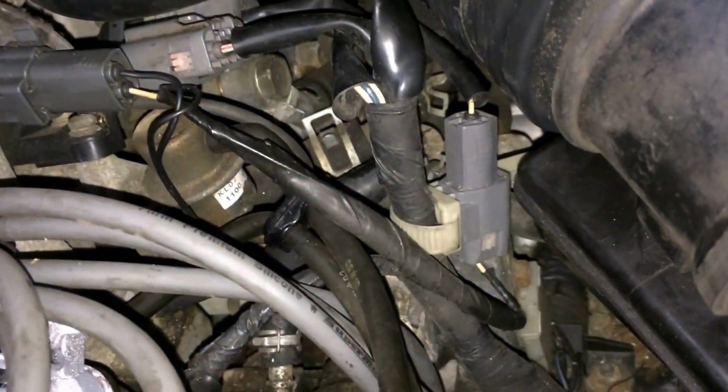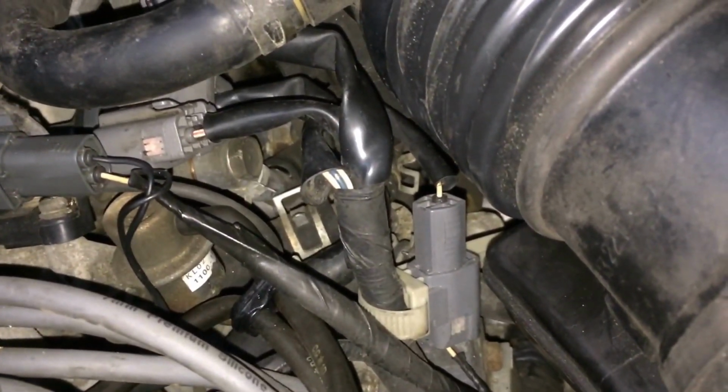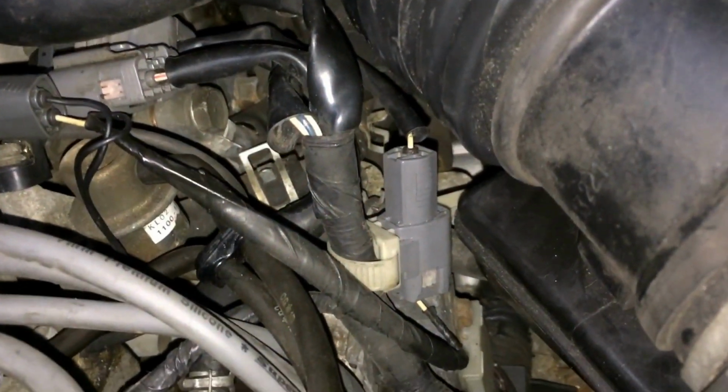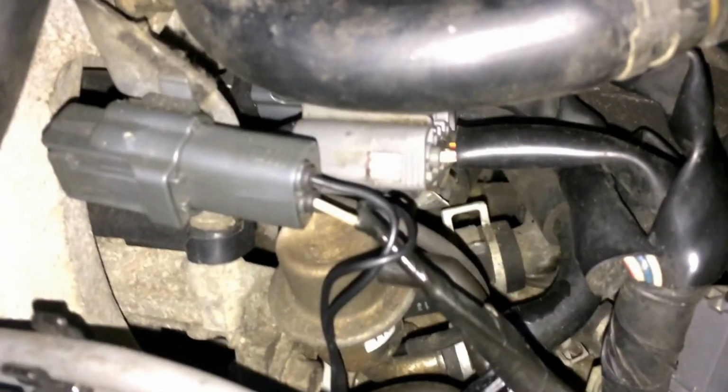The inner one, for some reason, well, it does follow gravity. It has a tendency of falling down, and if it does, again, keep an eye on it. Expect it. I will leave that for the very last. Put a rag at the bottom just to make sure that you can grab it, or put your hand under it, or just grab it. And when you take the fitting out of the gas line, you can just lift it up after you take the through bolt out, which is a banjo bolt, by the way. That's a gas regulator right there. And this should come up as one piece.